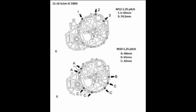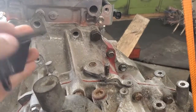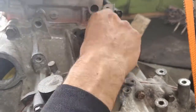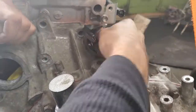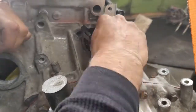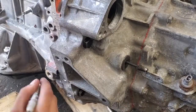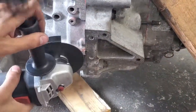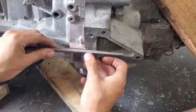Follow the chart pattern after the surfaces are completely mated and torque in the order shown. One of the top 12mm bolts needs to have the black shift mount installed — it has a small extrusion that fits into the adjacent bolt hole. Slide the spring clip on it and torque it down along with the other bolts. The other shift mount can be installed later. Now you can install the three transmission mounts. Starting with the rear mount, you must grind away the small notch on the engine that would otherwise interfere with the transmission mount surface.